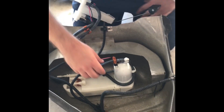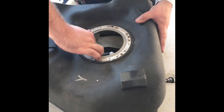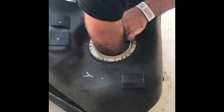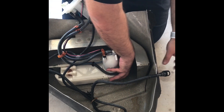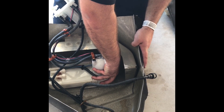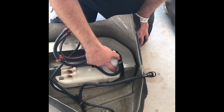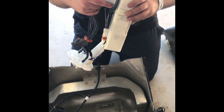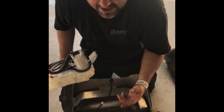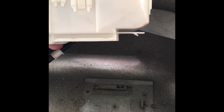To remove the factory basket — and again just get a visual here — put your hand in from the front; here's your hand, this is all the space you've got. You're going to grab, lift the tab up, and then pull forward and slide forward. When it's released from the rail you'll be able to lift and bring it out of the fuel tank. I hope that makes sense and gives you a good visual of what the rail and tab look like. Hope that helps!